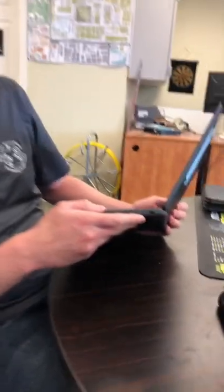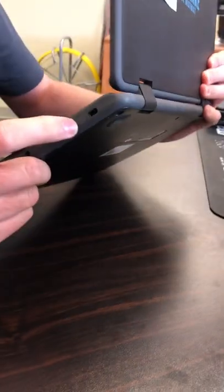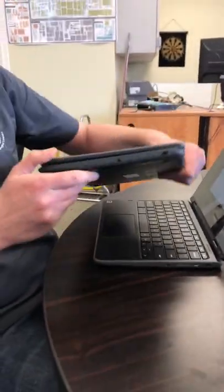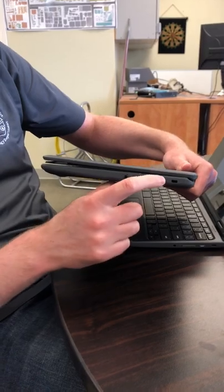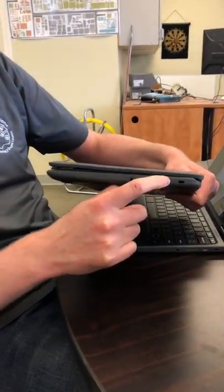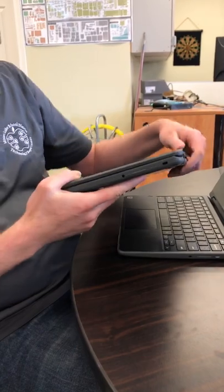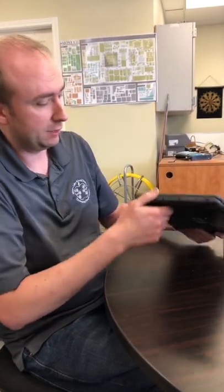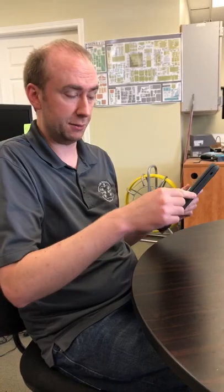Touchpad not working and power button not working — is there a key to looking at those? Yes — for the Yoga's power button, you'll hear a little click if it's working. If there's no resistance whatsoever and it just goes in with nothing pushing back at all, you'll know it's broken. For headphone jacks, you can look on the side and usually see something broken off inside from headphones, or just put a pair of headphones in and see if it goes all the way down.